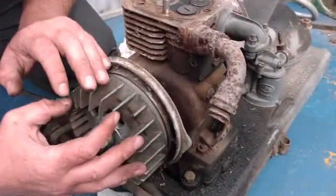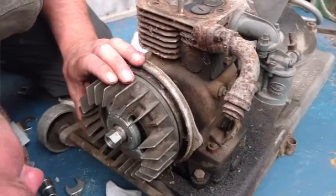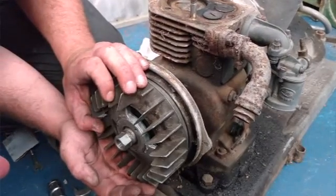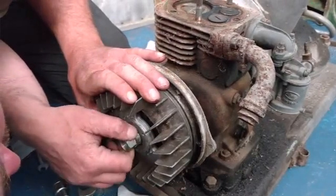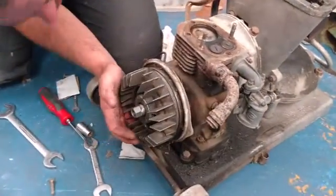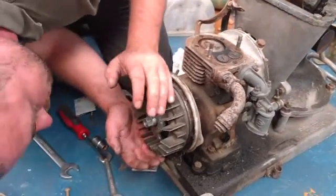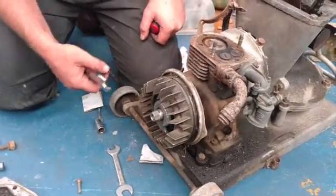There's that little arrow. Making sure you're not turning the engine at the same time. The points are open - it looks like they've been open a little while. This is known as a Y gap, so we only want them just coming open. That arrow signifies the high spot on the cam, so it's not really a timing point. Right here the points are just cracking open. So we're going to nip it up at that and then tighten the bolt down and check we haven't moved at all. Points gapped and cam set at three sixteenths BTDC. We need to get this retaining nut fairly tight, otherwise if it backfires it will just throw the timing out.